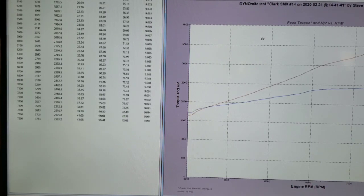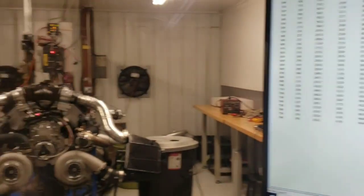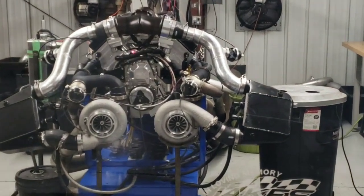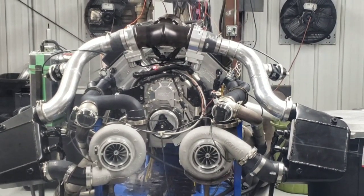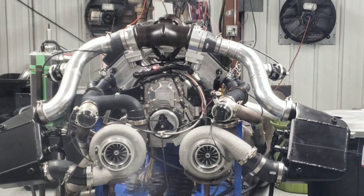The tune-up looks really good on this thing so far. That was the live dyno pull right there as you're seeing it. I'm trying to teach you guys something other than just the naysayers running their mouths — that's why these things run so good at these lower boost numbers, because I tune for it down there so they can utilize that. They're just in a very efficient spot in the compressor map, which is why they make so much horsepower and why they make more than 1-to-1.